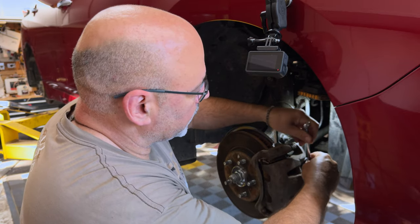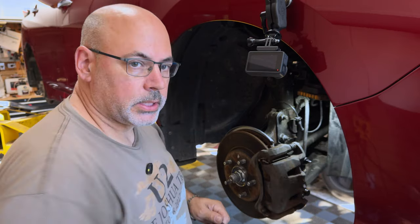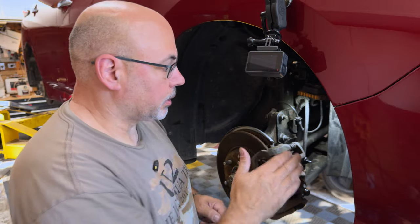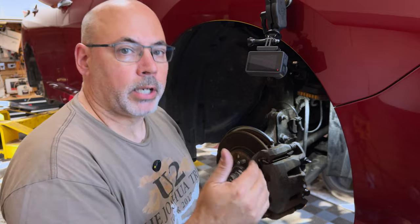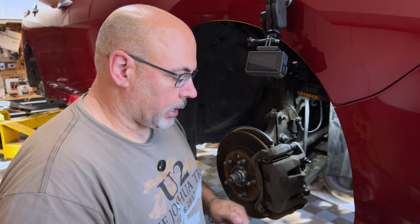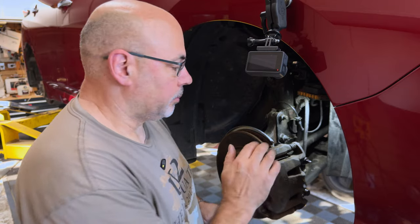You can see that's now loose. I'm using a ratchet 10 millimeter here. It's easier to use one that isn't a ratchet so you can open and close these. It's not so important when you've got pressure in the bleeder though. That's what I love about these — there's always pressure, so there's never air going to be sucked back. There are my hot tips for making sure every one of these can be loosened.